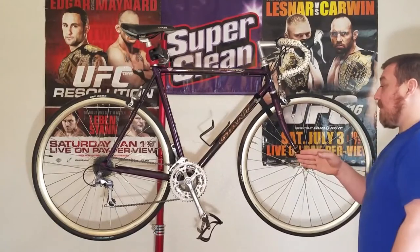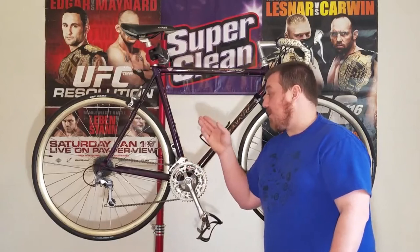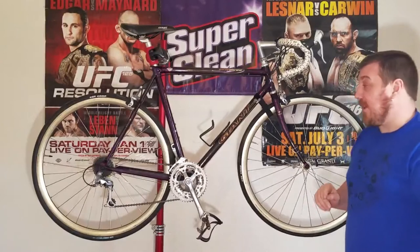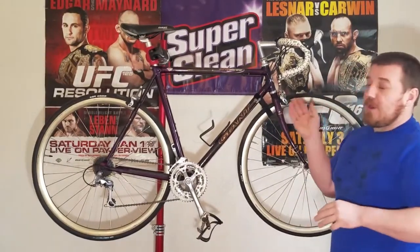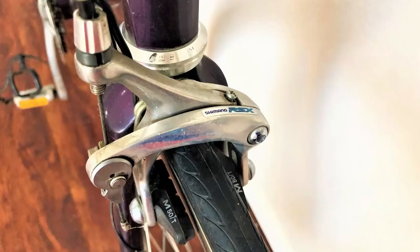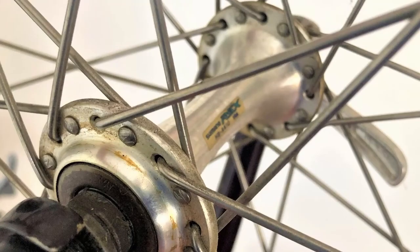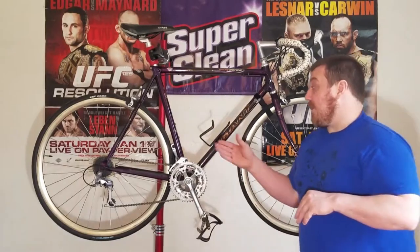As far as the remaining drivetrain, I'm going to keep the cranks, the front derailleur, and even the 7-speed drivetrain. One cool thing you can do with these vintage wheels is upgrade from a 7-speed cassette to an 8, 9, or 10-speed by changing out the freehub on the back — I have a video on that as well. Unlike a lot of cheaper bikes out now like your Trek 1000s and others — Cannondale does it, Specialized does it — they use off-brand brakes. This one has Shimano RSX brakes, both front and rear. For the hubs, these aren't Alex wheels from China. These aren't ones you need to take to a bike shop to get trued with bearings repacked because they're trashed from the factory. These aren't the highest-end Shimano wheels, but they're still sealed, still very high-quality hubs, front and rear.